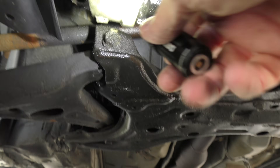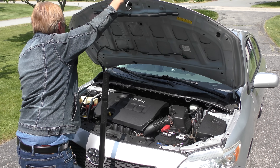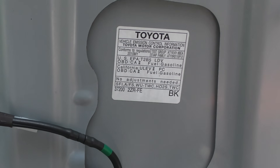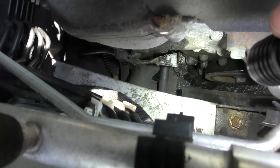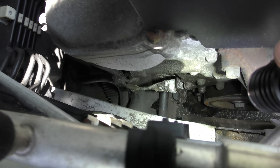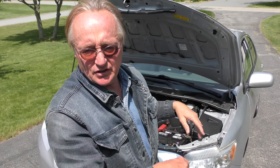Now it's got a tiny bit of oil coming down here, so we'll look under the hood. It's a four-cylinder dual VVT-i — 2010, 1.8 liter — it's practically the same engine that's in my wife's Matrix, a 2007 1.8 VVT-i. These things can run forever. You can see he's had the oil pressure sending unit changed; sometimes the light comes on. You can see it's kind of oily around there. The person they bought the car from did that, and I can see it's probably a cheap aftermarket Chinese-made one. I'd say change that out — that seems to be where the drip is coming from.